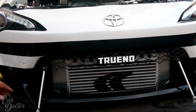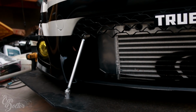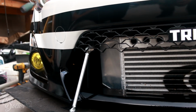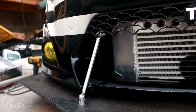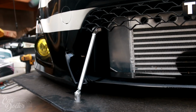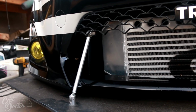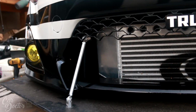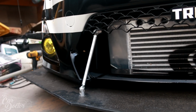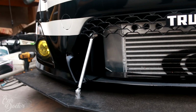If you look here by the rods, there are some little steel plates, I guess you can say, that I added. This was to add a little bit of ducting to my setup, so that any airflow that goes into that area is going to go directly through the intercooler, through the oil cooler, through the condenser, through the radiator, and the condenser is actually sealed off. I put some foam pieces in all of the gaps, so any airflow that goes towards the center of the car is going to get effectively forced to go through the radiator and exit nowhere else. So that's a big plus.